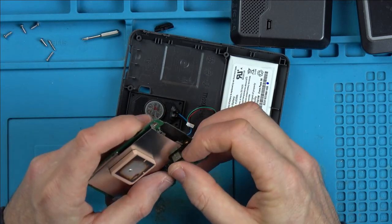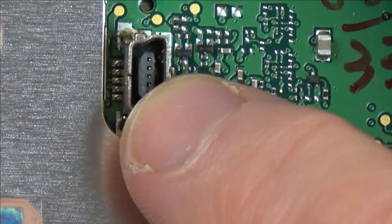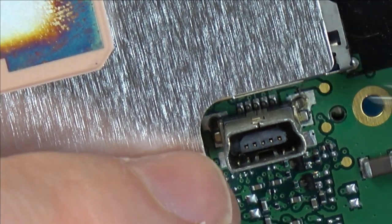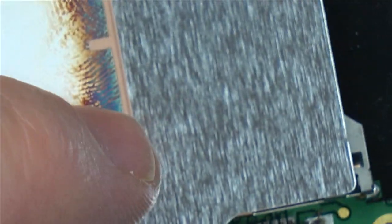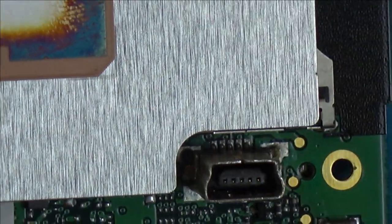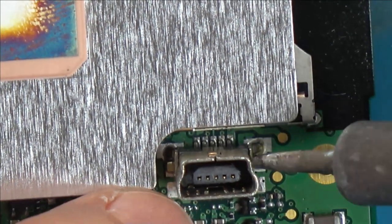Port here - what's going on? The port's broken there, but are the pins broken at the bottom? The port's broken, but is that side broken? Yes it is - can you see all those pins lifted here? Annoyingly this shield is in the way. How easy is that shield going to be to remove? Even if I move it, the SD card is in the way - what an annoying place to put that. Here's my soldering iron. Is it even going to reach in there? That's going to be tight. I'll get some flux and try it. They're all broken. I'll be able to get to these ones no problem - they're just the ground pads, the anchor points.